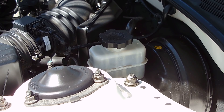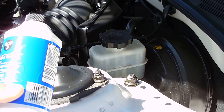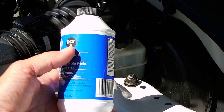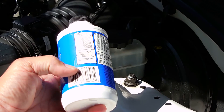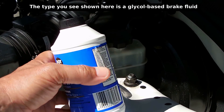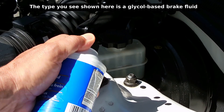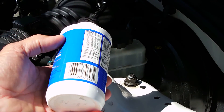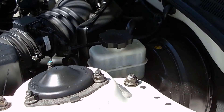It's important to note that non-silicone brake fluid is hygroscopic, which means it wants to absorb moisture from the air. If you read the side of the bottle, it's going to say make sure the cap is kept very tight, and the purpose of that is to prevent moisture from being absorbed into the bottle.